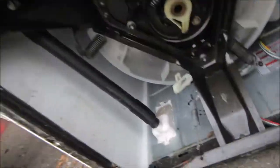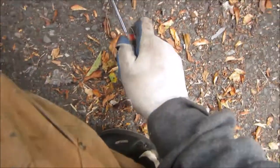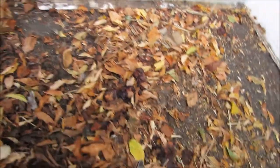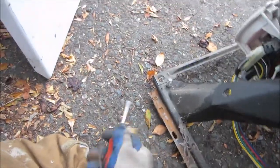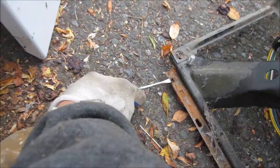We're going to have to take the front off and look inside there. Here's how this panel fits — there's a little tang that the back part has to fit into that back hole. There's also a hole up here in the front — this has to go underneath the front lip. That tang goes underneath this, and you can see this should have a clip that comes up like this one. If you're careful you can bring these back to life and just gently bend that up again, then you have a little tang so that it will catch.